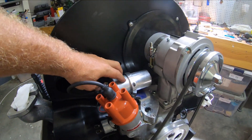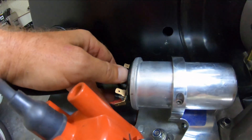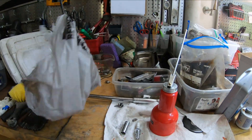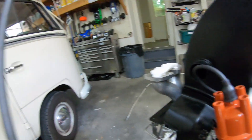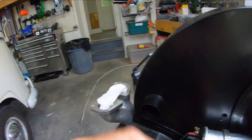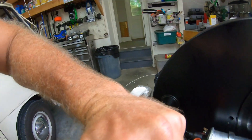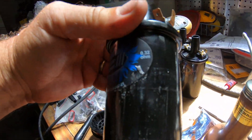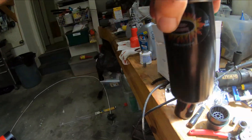I have a new Brazilian Bosch coil, 3 ohm. What I noticed is the Pertronix boot is too loose on it, so I bought just a regular 99-cent spark plug wire and I'm going to take the boot off that and see if it fits better. That one fits great, so I'm going to replace the big Pertronix boot with this one. I also made the mistake of buying a 0.32 ohm coil first, which didn't work well.